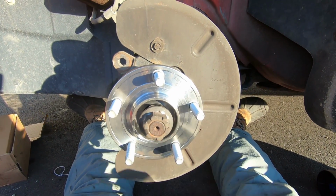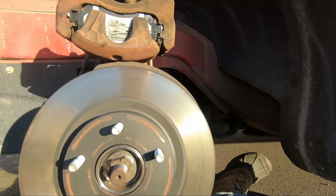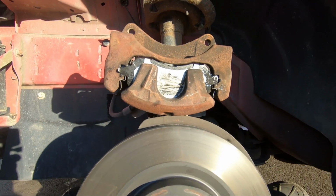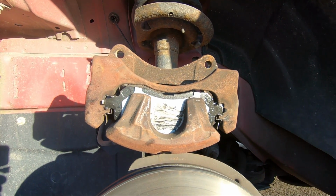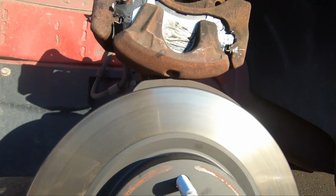And we'll just cover those last 2 things, but if you want to peace out here, I gotcha. All right, that rotor's back on, it's decided on. Now we're gonna take this caliper. We made sure the brake pads are in there right, and we're just gonna put that back on. 2 bolts on the back of that caliper. I'll show you what it looks like.